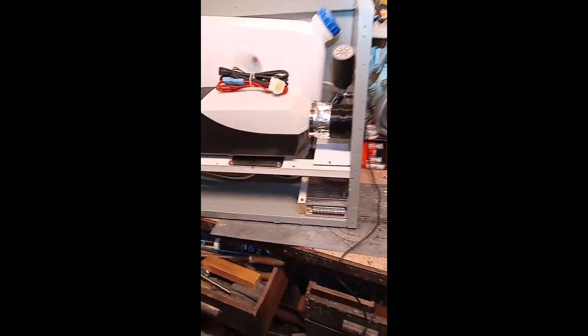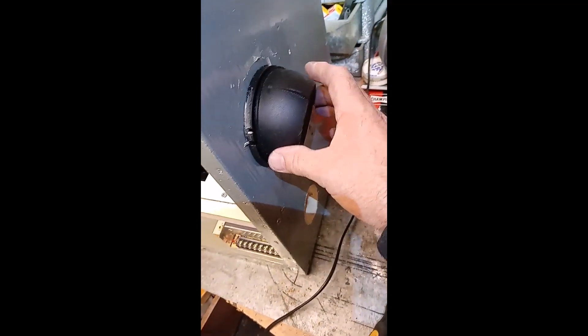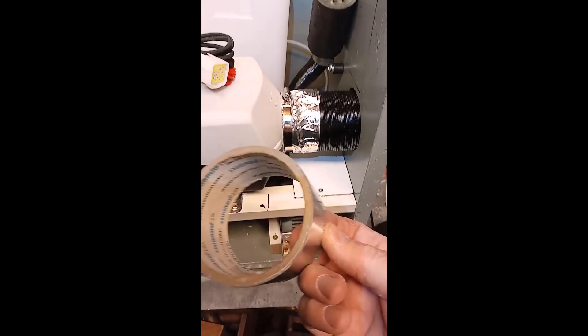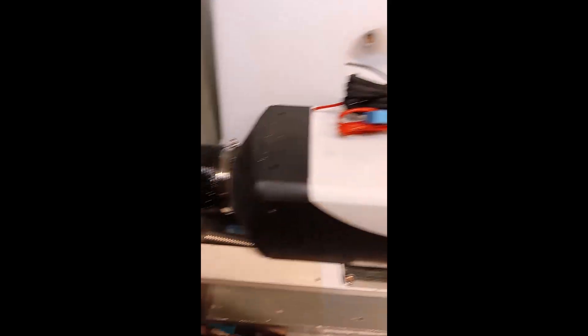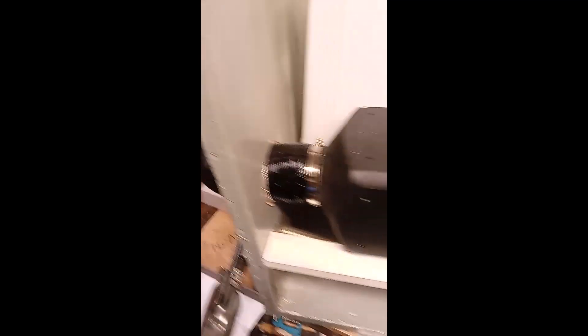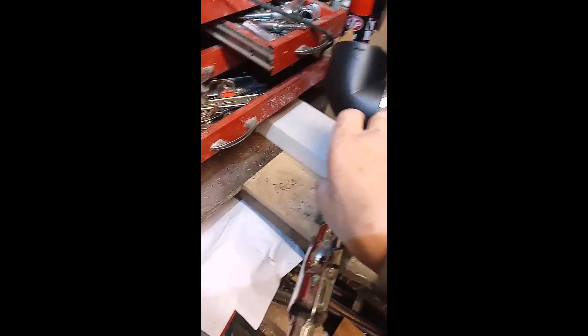It's ready to go at the back of the house. I've had to take this mesh off here which stops all the rubbish going in. I'll put a bit of this inside here and then this will go on the end — it's a directional one. A bit of heat-proof tape on there, that's the right size. These angles are what's going to take the pipe up to the house. The ends are a little big so you will have to trim them — cut a few V's in it, trim it down to go inside, then you can tape it over.